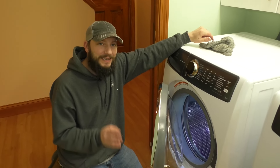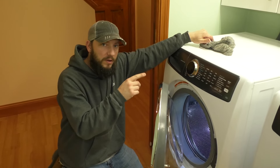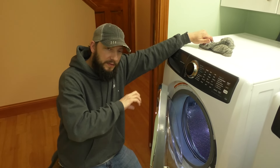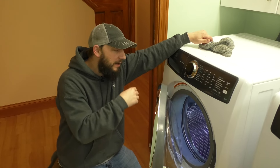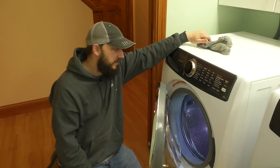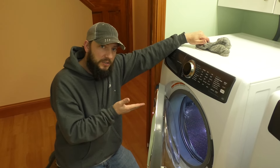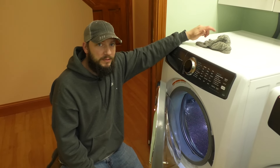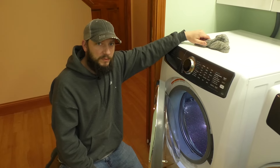Then I'll leave this open so the moisture and humidity doesn't just sit there and cause things to get moldy like it's been doing — leave it open, let it air out between loads, make sure it's as dry as you can get it. If it still stinks, it could potentially be something wrong with your drain outlet — maybe there's no P-trap loop and water is sitting in there. Generally washers can tend to smell sometimes anyway, but if you had this situation with a very moldy door seal, I hope this video helps. Thanks for watching.